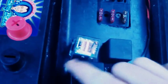I made this little electrical box that wasn't in the last video, and I put these little troubleshooting lights there. Basically, whenever the circuit's energized like it's supposed to be, that light lights up, saying that the power down the line from the relay is triggered on. It's not on the trigger side that would show there's a signal going to the relay. It's on the power side coming out of it.